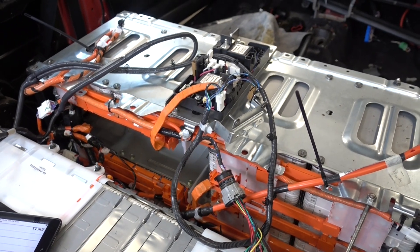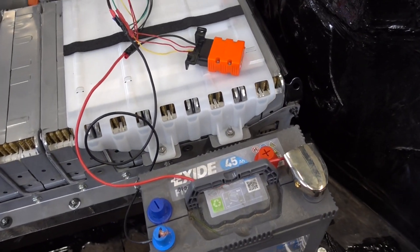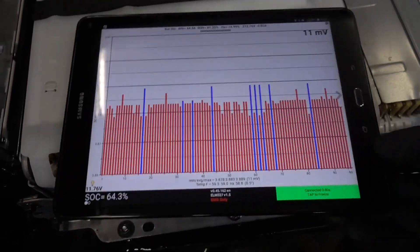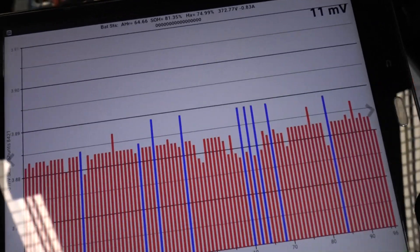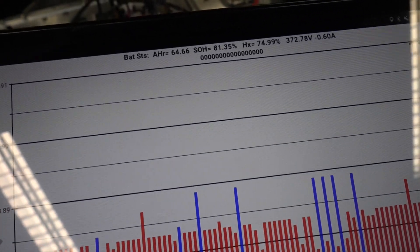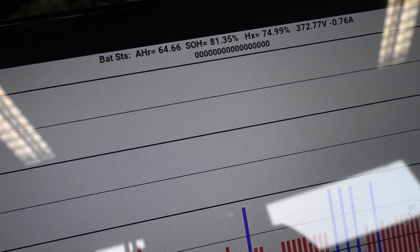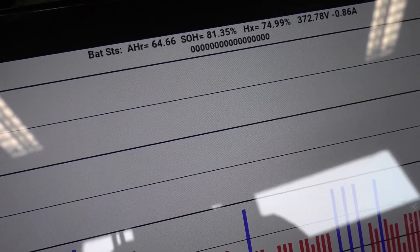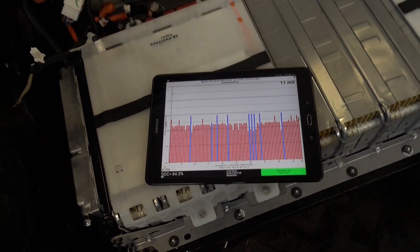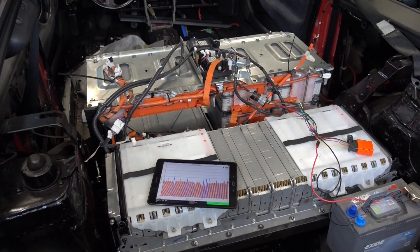After throwing the battery around a lot, I hooked it up to a 12-volt battery and a Bluetooth dongle so we can take a look at the battery stats. I'm very glad to report that the battery is working — it's currently sitting at 65% state of charge. The state of health is average or below average for a 30 kilowatt-hour pack, and that's the reason I chose this battery for this build because it couldn't have gone into a customer car. Now that we know it works, I can tidy this up and continue.